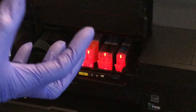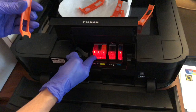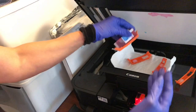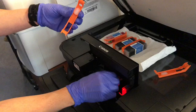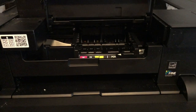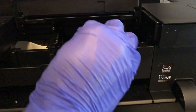I always wear gloves because this stuff gets very messy, so I have a paper towel. You want to keep these orange clips. I'm going to take out each of the cartridges — press in here with my fingers to lift it up, and then to put the cartridge on, I'm going to hook the little plastic piece around the end and press it so it closes. I'm going to do that for all five of them. I'm just going to set these aside. Now what I want to do is remove the printer head. I'm going to take two fingers, grab it, and then pull it and lift it out like so.